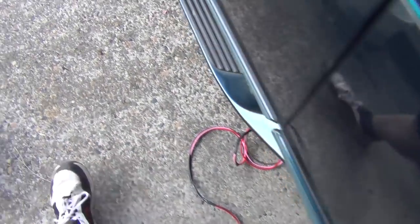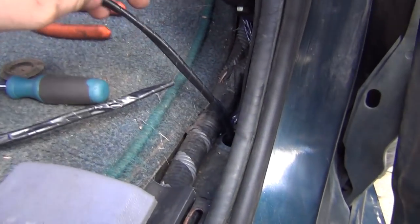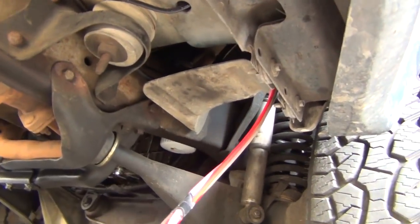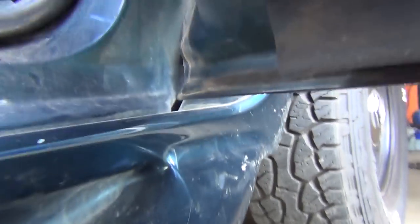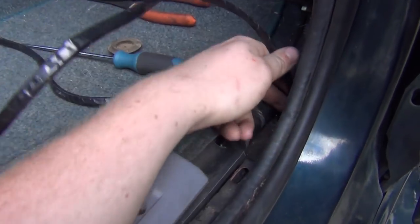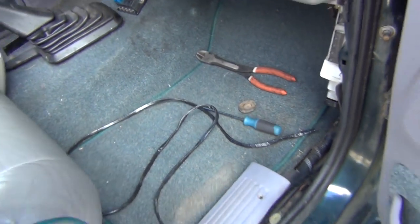So I've got this harness here routed down — and I'll show you what I did, it's pretty clever. I found this grommet right there, cleaned that all out, got some of that cab sealer off it, pulled the grommet out. Went through that hole right there and then routed it up. This is all the trigger wires for the relays. I'm about to route this up through here and then cut out a little hole so both of these harnesses can go through. So that means I did not have to drill any holes. If I wanted to add more, I can run it down through there and just get a bigger grommet.